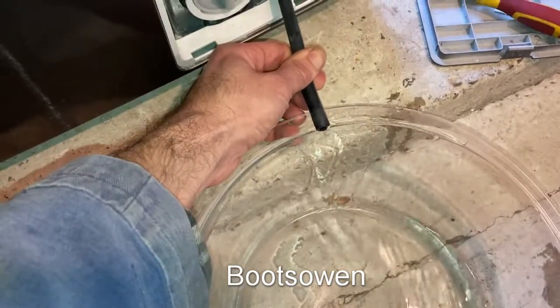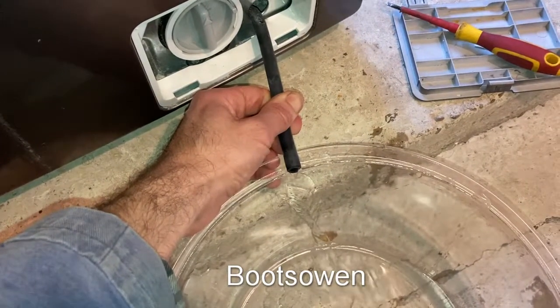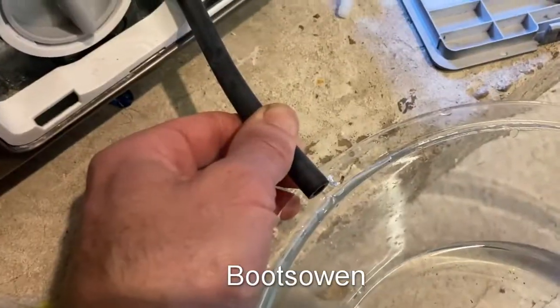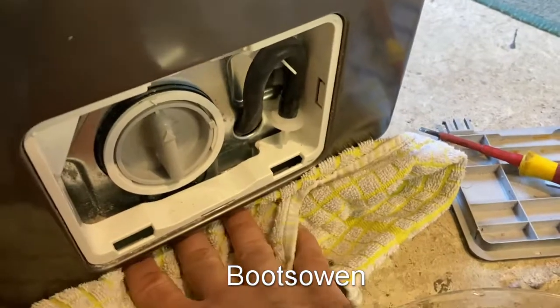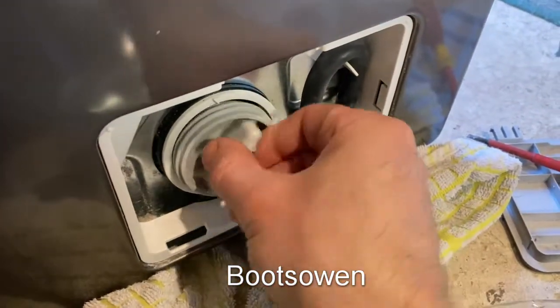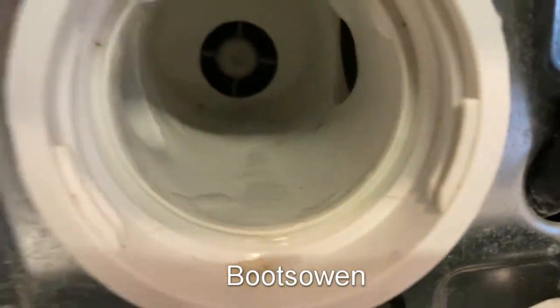The first thing I always check with the washing machine is the filter, so that's what I'm going to check first — could be something in there confusing it. That water's come out lovely and clear and it's just finishing off. I'll put the plug back in and open up this thing. I've got my plug back in, the hose folded up, and a bit of cloth here — an old towel — to open this. There might be a drip left in it or there might not, but there's no fluff in it and that's quite good and clean.